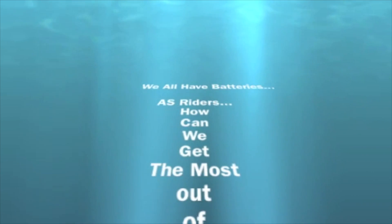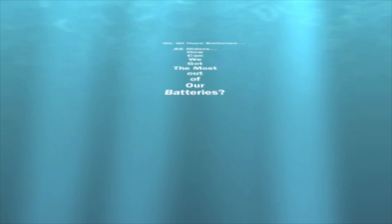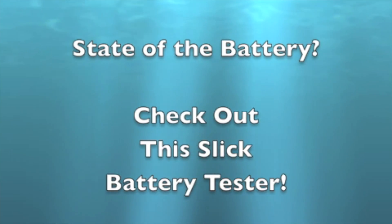What's the best way to make sure a battery lasts the longest? Always check the battery during routine maintenance, especially on your street bike. Liquid-filled batteries have a vent hose — make sure that hose is always hooked up, because during hot weather you'll lose water or electrolyte evaporation. Also keep your terminals clean; there is battery cleaner spray you can use on the terminals to maintain a good connection.